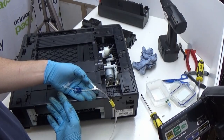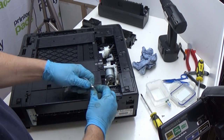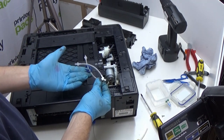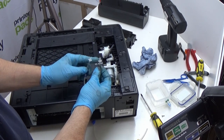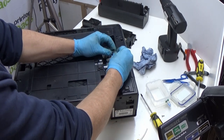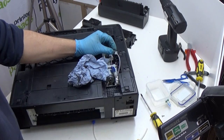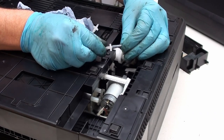First, disconnect the wire fitting from the long tube extension, so you're left with your longer part with the tube clamp on the outside and the inner piece going on the inside. The thicker barb connects into your main waste tube — get a bit of kitchen towel, clean that up a little, and then slowly and surely push it onto the main fitting so it's on nice and tight.